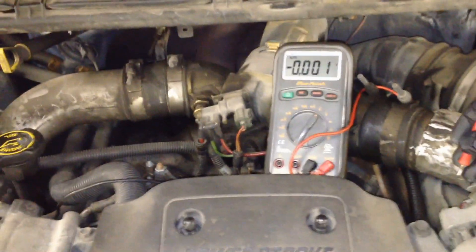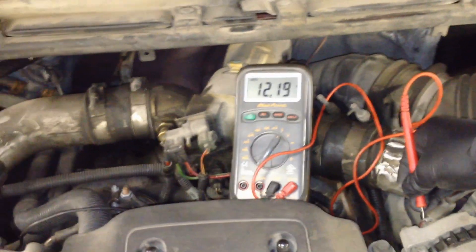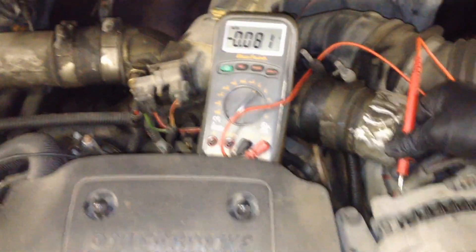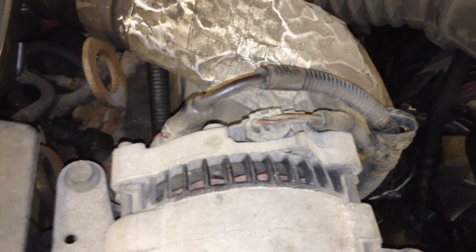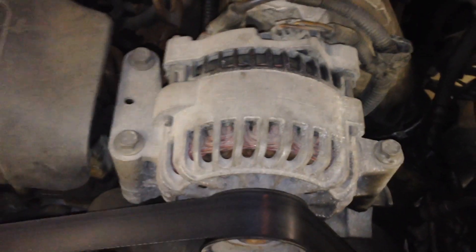First thing — running alternator check. Voltage is 12.2 at the alternator still. We know the alternator is definitely faulty. Now let's do a voltage drop real quick. We're doing a voltage drop test, positive to positive. My leads are backwards, that's why it says negative, but you can see it's well under the 0.5-volt limit. So that's about it — these are very simple to diagnose. They're right on top. Do a few checks like I've shown, plus the voltage drop test, and you can be rest assured your alternator has internally failed. It's usually the regulator — the gray part — but they come pre-built into it.